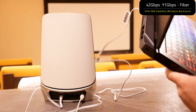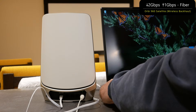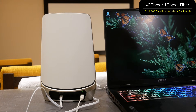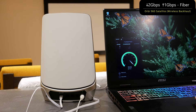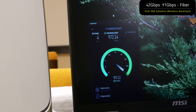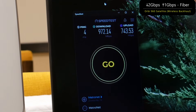My Wi-Fi is off on my computer — it is hooked up via ethernet to this satellite. This is where one of the strengths of Wi-Fi 7 is going to come in, but this is the Wi-Fi 6E router. Even in wireless backhaul configuration we have really low ping at 4 milliseconds. We're getting 972 down and 743 up. So 972 down, 743 up while this laptop is connected via ethernet to this wireless backhaul node.